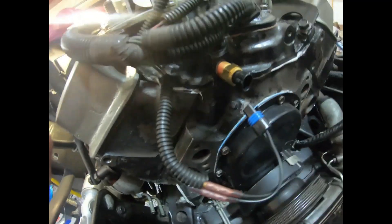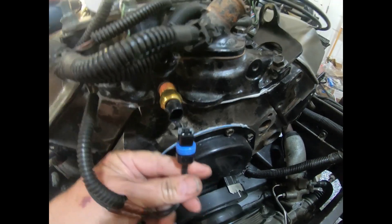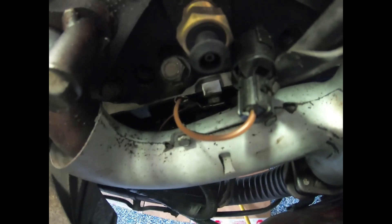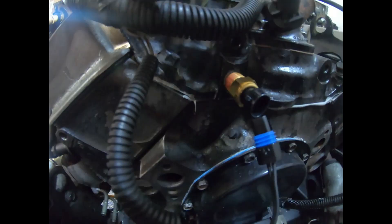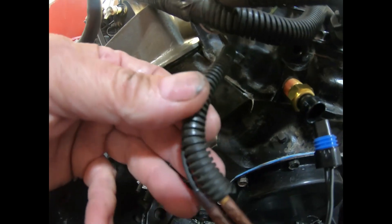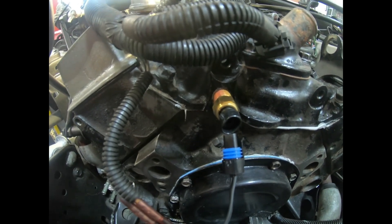So those are our three sensors. Now I will say that on the '84, this temperature sensor didn't originally come with this style connector. It came with the umbrella style — like the one for the cooling fans — except the cooling fan one was an umbrella style with one wire, and the ECM one was an umbrella style with two wires. However, you can no longer get that style, so you have to retrofit your wiring harness and put a new connector on to exchange it for the newer style.